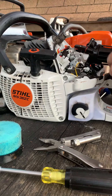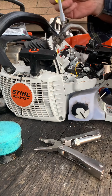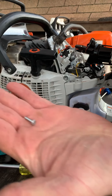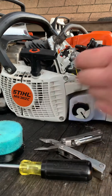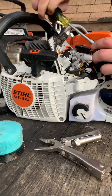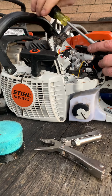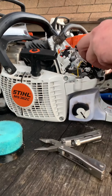Make sure nothing slips off. Take the T10 torx and remove the two screws that hold this baffle in place. I already took one off — I'll take the other side off for demonstration. Back this screw off and the baffle will start to come off. Take both of them out and set the baffle to the side.